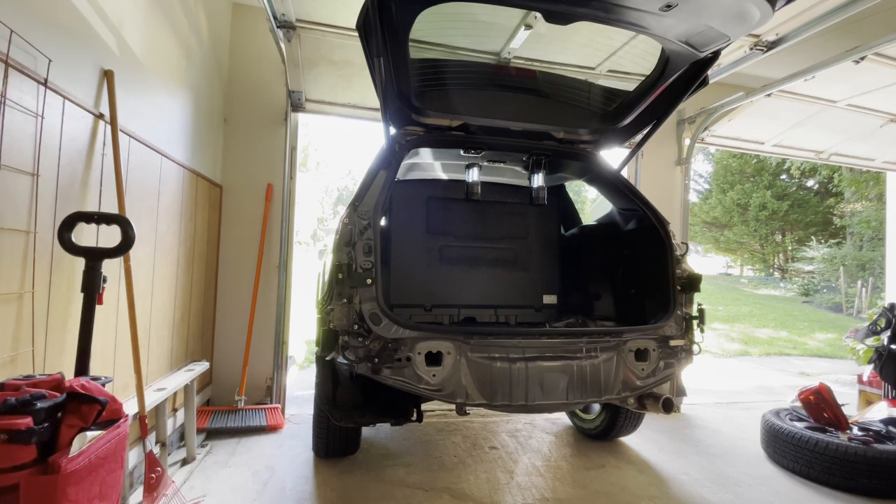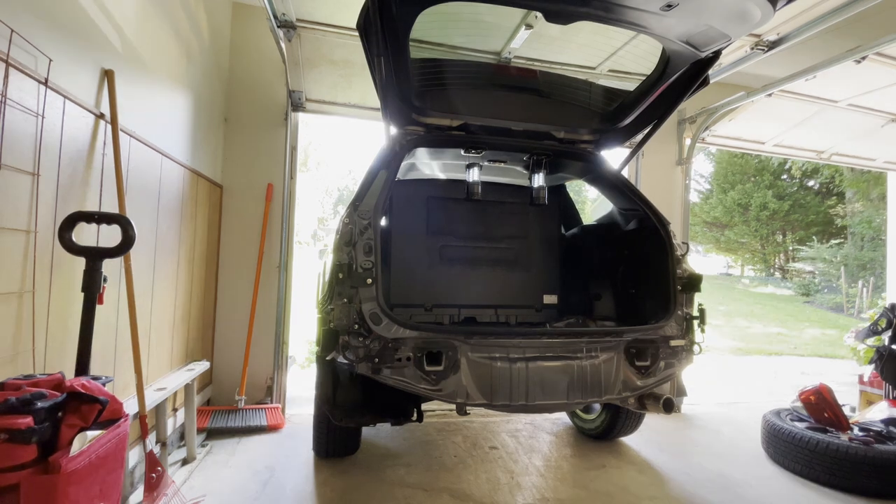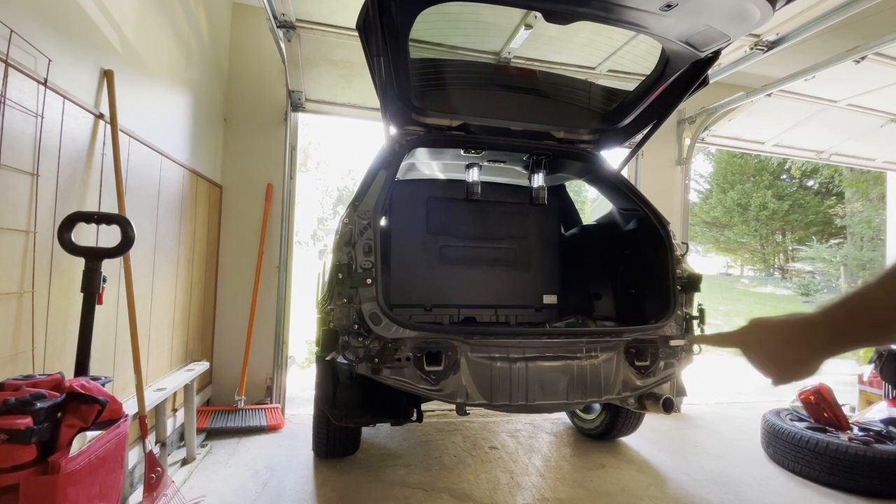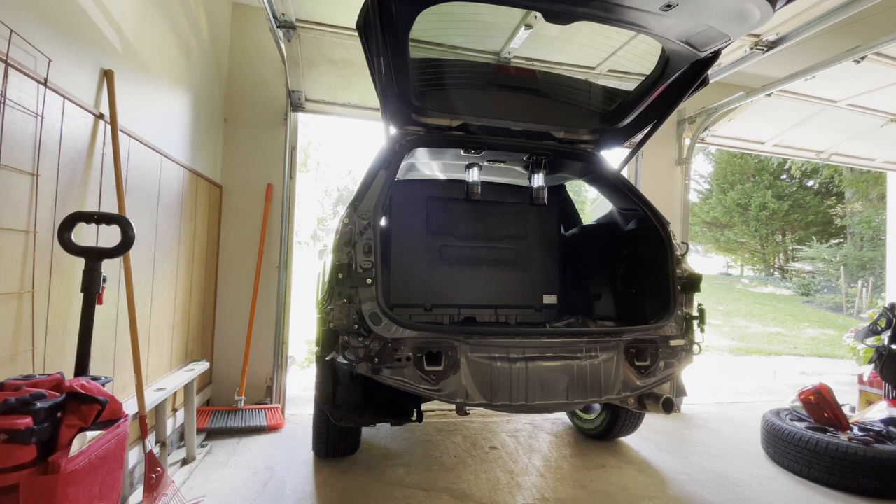I got the rear crash bar off. I did try to tie it up - that ended up being a mistake. There are nuts in two of the spots so there are still bolts protruding from the frame that would have held it up. I actually bumped it off when untying my rope. Just take everything off and let it sit on the bolts as long as you're in a flat location. I had some flat black Rust-Oleum, so I used that to touch up around the exposed port points to help with rust prevention.